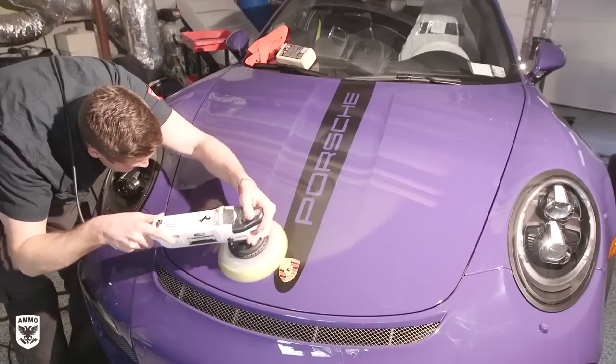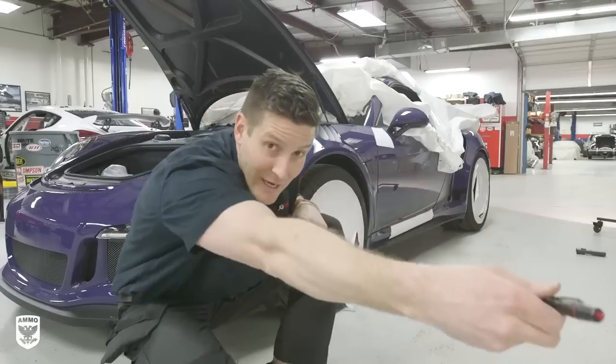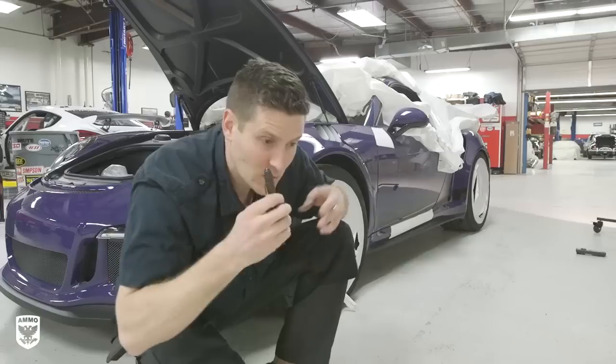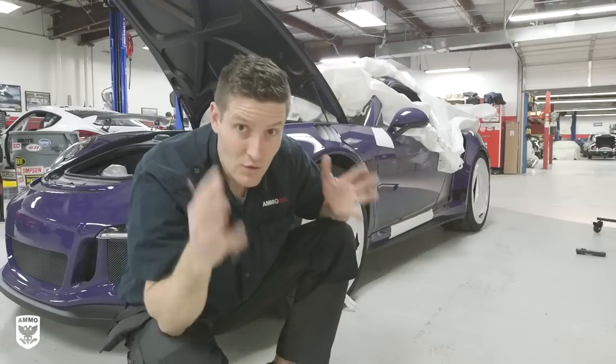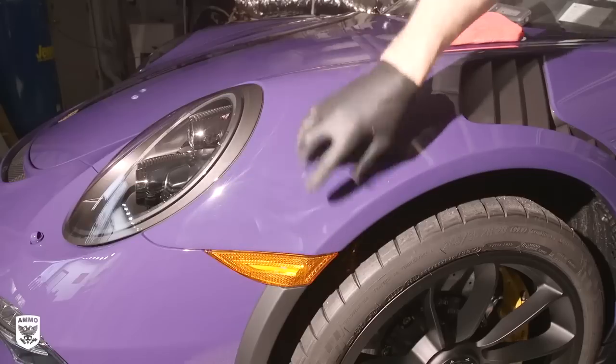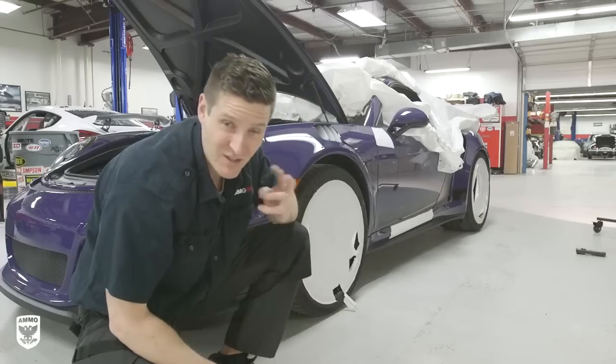But do you see how important it is to actually do this yourself? Find a pen light, shoot it at an angle. Remember, behind your eyes, you can see the coloration from panel to panel. At an angle, you can see scratches. Do that, and it'll save you a fortune at the dealership. Use that technique, and you'll be better for it, and you'll know the history of your car.